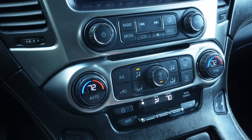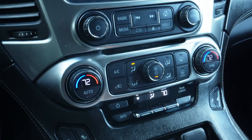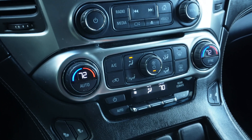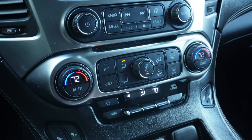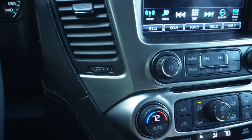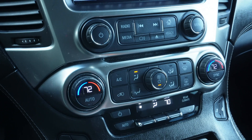If you want to know if your car is equipped with an auxiliary heater when it's cool outside, just start your engine while the engine is cold, crank up the temperature, turn your AC off, and see if you're going to get warm air coming out of your vent. Right now temperatures are in the eighties — I already know that I have an auxiliary heater, I don't have to check it.